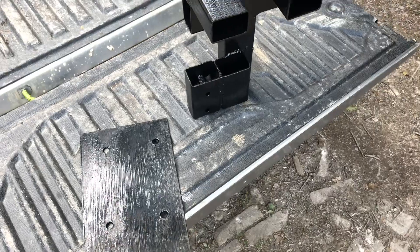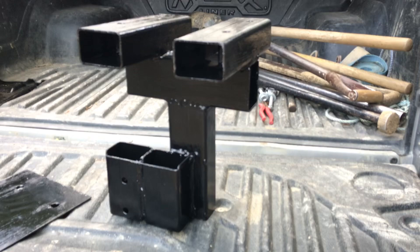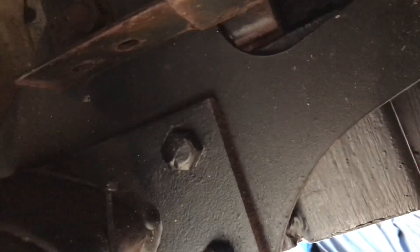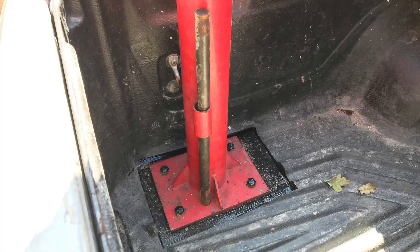I also made this plate which will just sit in the bed where I cut the load liner. Here's the underneath, which shows how I bolted it — this is on a Mark 8 Hilux, the newest shape. Just those two bolts there which go through the pre-drilled holes, then four bolts up through the top. Here's the view from the top of the bed, and I positioned it here so that I had enough reach to reach over the tailgate.